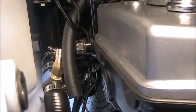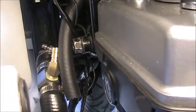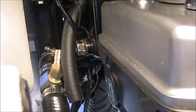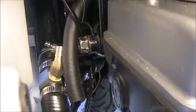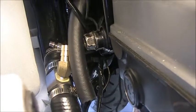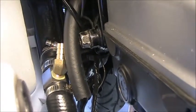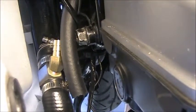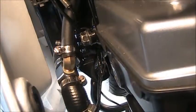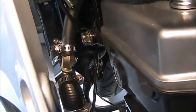Back around on the left hand side of the bike to attach the bypass from the thermobob back into the return-to-water-pump line. The length of tubing sent with the kit was just about an inch and a quarter too long, so I trimmed it right there. Now the bypass line is connected right up — and that's the end of it. The thermobob is installed.